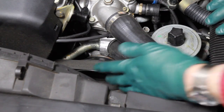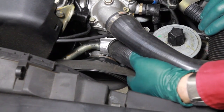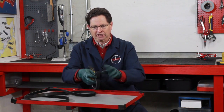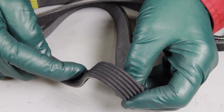Now it's not always easy to do this down in the engine compartment. Look at my 300 SL here — just getting down in there to change the belt is going to be a challenge, and even looking at it isn't easy. You'll have to get down in there, twist the belt, and try to look at the condition of the ribs. When you look at the new belt, you can see there's absolutely no cracking at all when you reverse the bend in the belt.